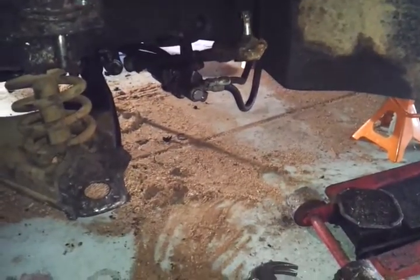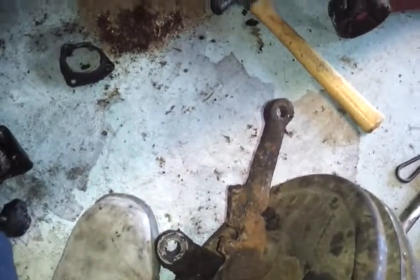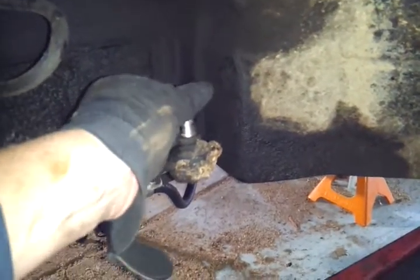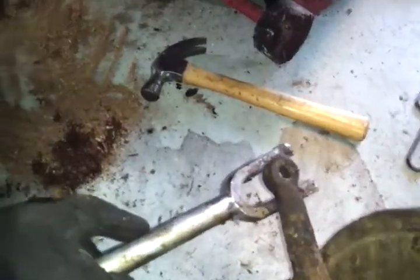To release the outer tie rod, you're going to have a castle nut on it, which is going to go right here on the back of the drum. I like to flip it over and screw it back on as best as I can. You can put a pickle fork in between, but realistically it's not really going to help, since it's coming underneath you'd be trying to pry it.